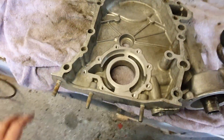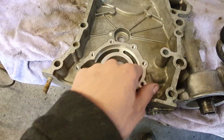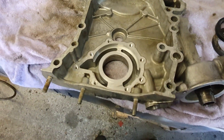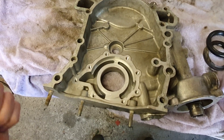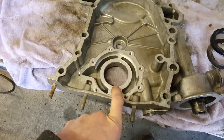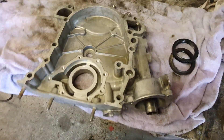I bought a new oil pump despite the old one being okay — it wasn't broken, just a little battered with dents. It was just in spec actually, but this engine had an oil pump problem. It was a pickup tube that got full of silicone — that was the issue — and that failed the big ends, so the crank has been reground. So I've gone belt and braces and got a new pump. It's a machined steel piece rather than sintered, from Turner Engineering.